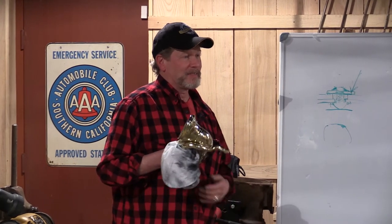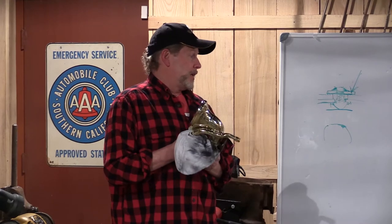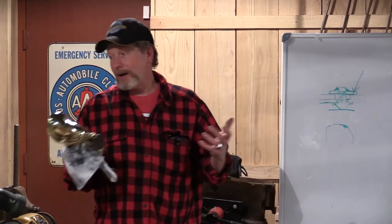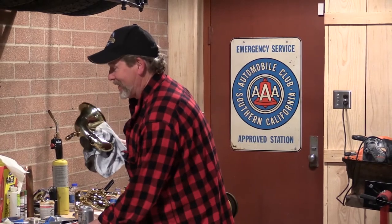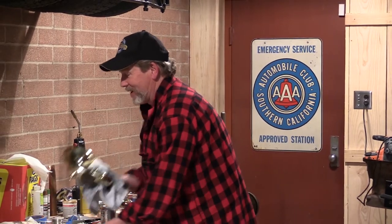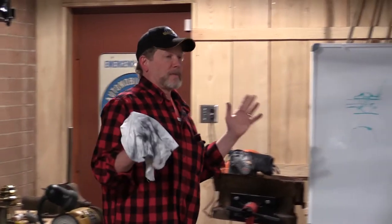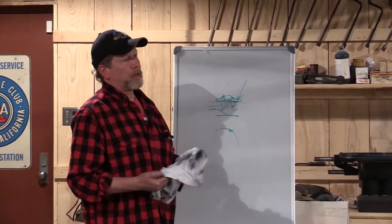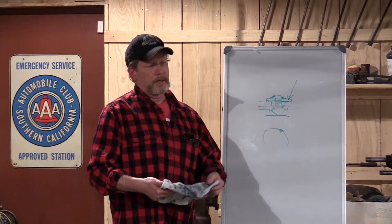There's been a lot of discussion about lacquer. I thought I'd try it — I did a set of side lamps and a tail lamp on my town car in lacquer. I used Helmsman glossy and did everything by the book. A professional polisher in St. Bernard in Cincinnati said to put a wicked shine on there, then wipe it down with acetone to get that slip agent off — because that slip agent that comes out of these products will make your lacquer orange peel.